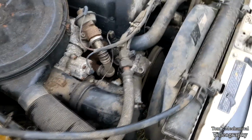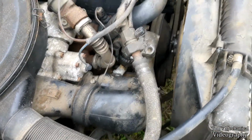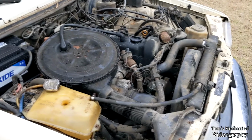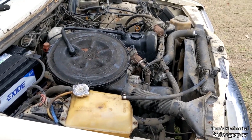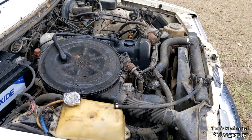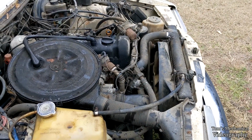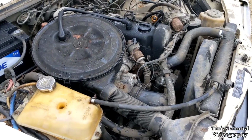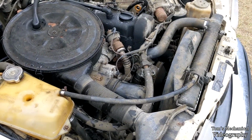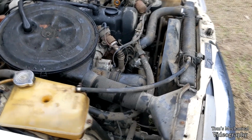But push comes to shove, that's the only thing, is to get that out of there and see if there's just a big clod of garbage right down in there. I'm gonna keep hoping and praying that this flush is going to dissolve whatever's in there, and if I've got to run like 5 bottles of the stuff through it, so be it. I really don't want to have to put vinegar in here, because vinegar will eat through metal if you leave it long enough, and it turns into like a biosludge as well. Citric acid probably isn't that great at deleting rust, but it'll definitely get rid of limescale, which I don't think I have too much of a problem with in here, on account of all the other horrible things that aren't limescale that I'm dealing with.